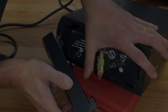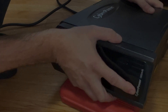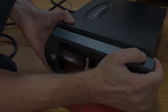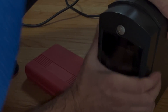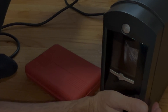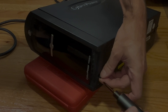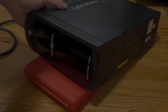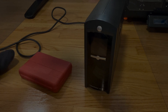Make sure they're not interfering with the LCD display, so bend those two connectors down a little bit when pushing the front panel back on. Remember, we have to push the front panel back on and then slide it upwards to secure it in place. To help with that, you can also stand the battery backup upright and push the device back down so the display locks into the correct position. Don't forget to secure the front panel again with that small Phillips screw we removed earlier. And that was it for this video — hope you found the information helpful, and if you have any questions or comments, please leave a message below.